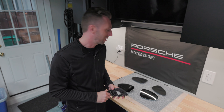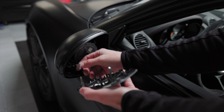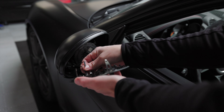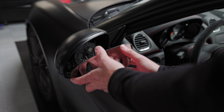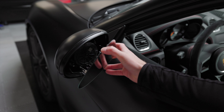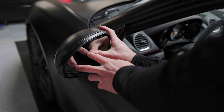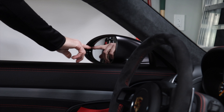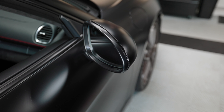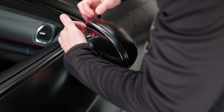I've got my aspherical mirror here and it installs the same way we took the other one out. Connect the wires to the contact points, then position the metal tabs into the top left and right corners. Try to position the glass the way you had it before you tugged on it, then press — and that's it, aspherical mirror installed. You might get a better grip by pushing it side to side to seat your fingers into that slot.